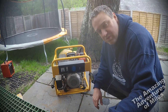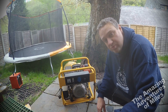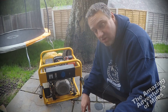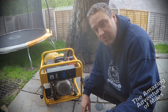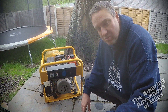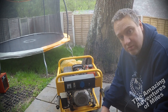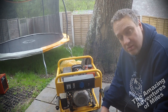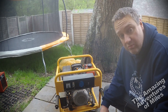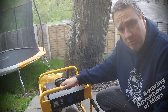That was actually quite straightforward to start, but probably because I'd had it running earlier — it took me quite a few attempts to get it going from cold, so it was already a bit warm. With the thinner starter cord on, you can start it, but just be prepared for the fact that the cord will probably break at some point. Yanmar do actually offer this engine in an electric start version, which would be heavier due to the starter motor and battery, but I think it'd be worth the extra weight.